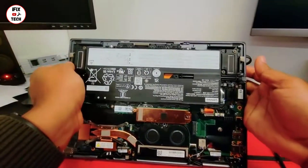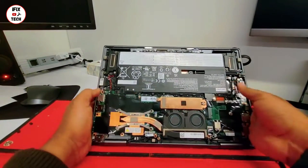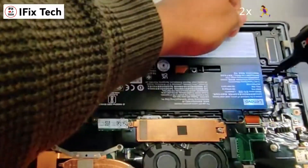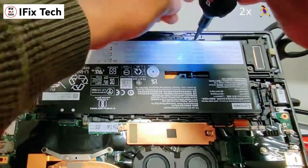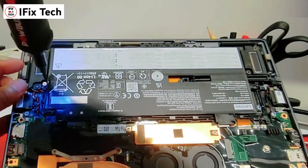Cover is out. By just looking at it, I love the design of this computer. Let's proceed removing the battery — that's the first thing you want to remove from the machine before playing with any component. All the screws are Phillips head, they have different sizes and different colors. The battery itself has 6 screws and they are the bigger ones on the whole machine.